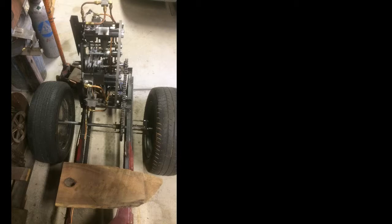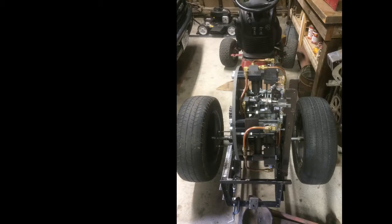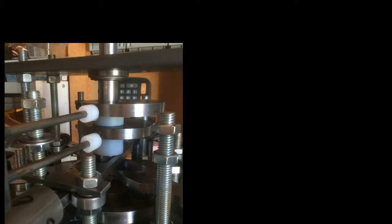It seemed to run everything just fine on my workbench, but when I put it in the test vehicle and tried to move it around a little bit, I found out that by pushing the mower backwards it would bend the pushrods — or the valve stems, I should say — and I can't have that. Since I make the parts and build the engine from off-the-shelf items and material, my longest running problem has been the valves, and I think I've finally come up with an idea that will take care of the valve problem. That's where my problem is.